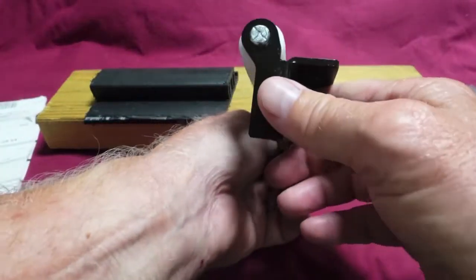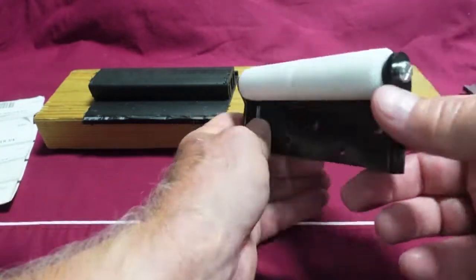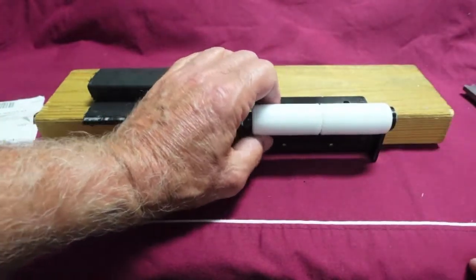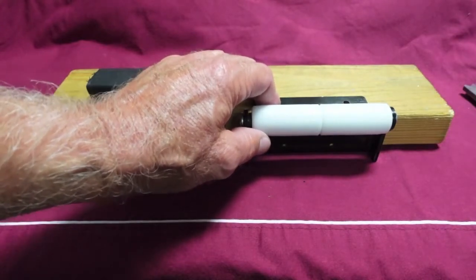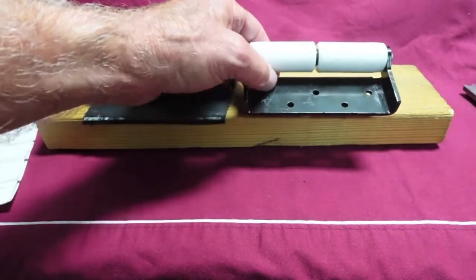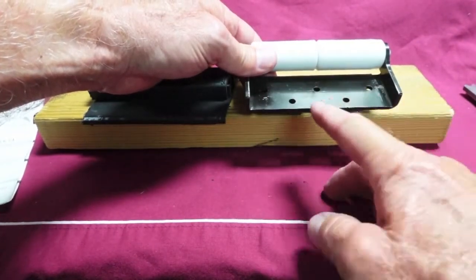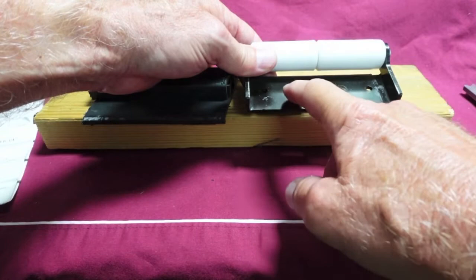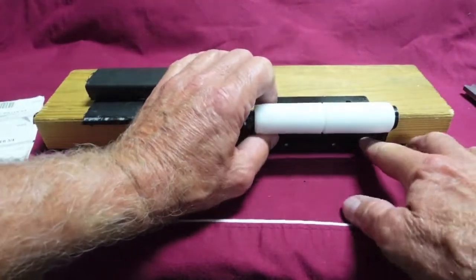The only way you get your 3/4 inch or your 1/2 inch is measured from here to the top of the roller. They have to go on this way. The instructions from BAL, you can get a printout from their website, and it is vague, but they do tell you to use 5 screws, number 10 or 12, and you may have to do some drilling on these a little bit, but use 5 screws with sealing washers to hold this to the side of the floor.